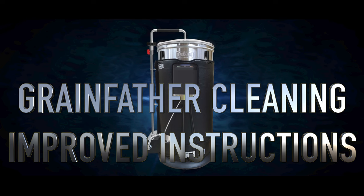Once this is done, simply empty everything out, refill with just fresh normal water and do the same thing again. Both cycles are where you heat to 55 degrees C and run between 15 and 20 minutes. One is with the cleaner and the last one is just with water to rinse everything out nicely.